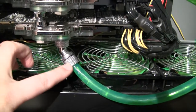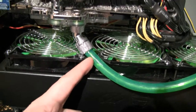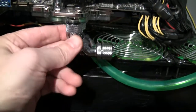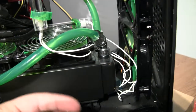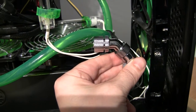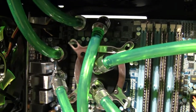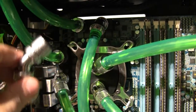There are a few areas on my rig that I particularly don't like. One of them is the GPU area. I even had to cut a fan to make sure that my tubing would go through the system without bending, but it's still a little bent and I don't like this. My idea is to use a combination of 45-degree compression fittings and adapters to run the tube parallel to the fan area, making a smooth 90-degree turn with no danger of kinking, giving me a straight line. I also want to connect MOSFET blocks with the CPU block, chipset block, and even the card.